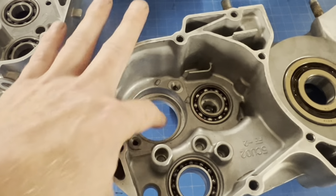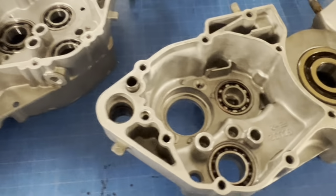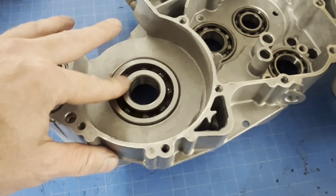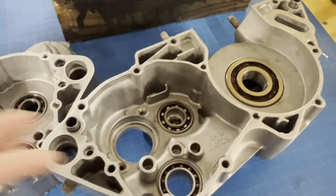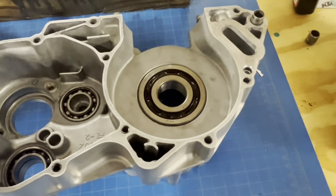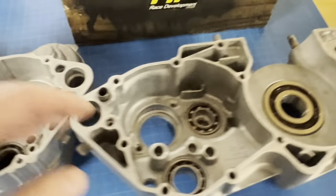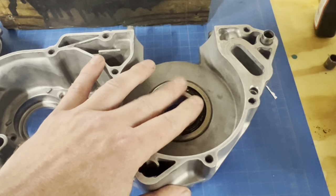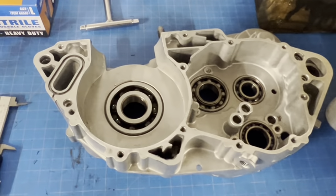To fit the KTM bearing we'll have to make a sleeve that reduces the diameter of the outer area. That modification won't go into this motor yet — we've got a new OEM bearing going in here. On the motor that did lose that bearing, we've got ceramic main bearings. They don't make power, but we've had lots of bearing issues over the last two years — nothing right away, but around 20 to 30 hours you start seeing failures. We've had two sets of main bearings go out, so we're going to try these ceramic ones — not sponsored — and see if they last longer.